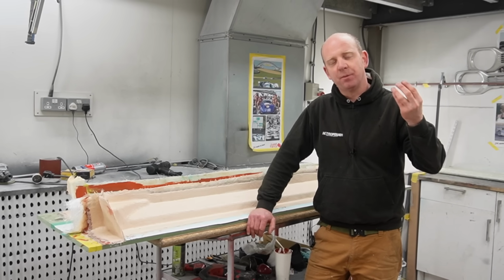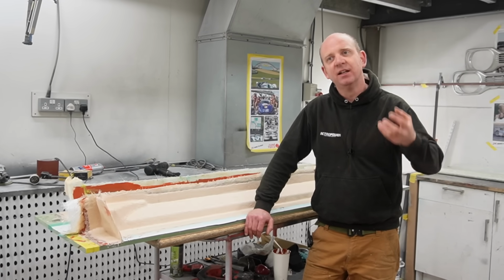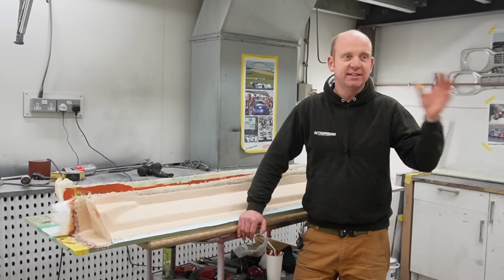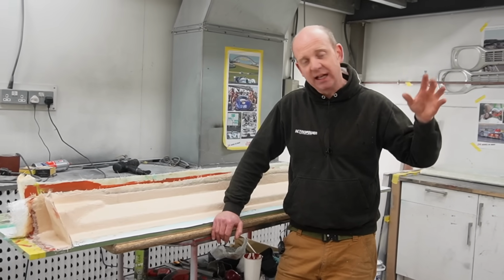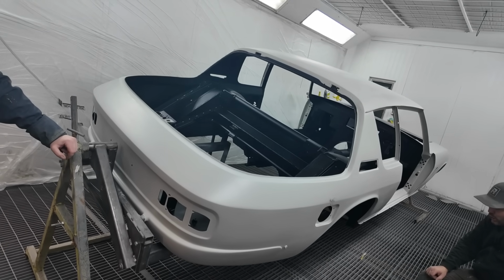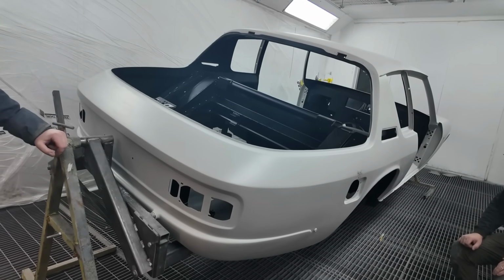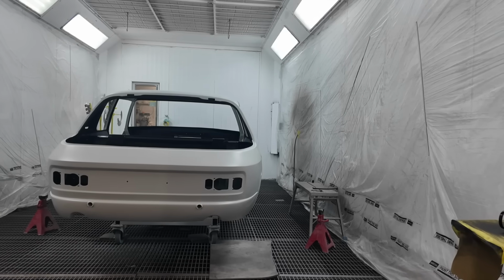That's tinted with a paint. We actually use a tintable Raptor, but just tint it black. You can buy the Raptor as black. We keep it as tintable, so we can tint it to any colour, and on that car it just happens to be black, so that's tinted with a 2K gloss black acrylic paint.